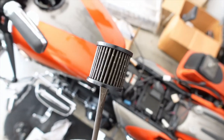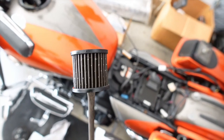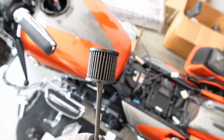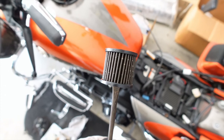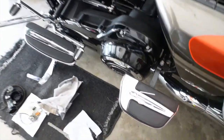Here's how my fuel filter looks. Mind you, I've had this bike since 2015-2016 and I only have about 30,000–33,000 miles on it. Harley recommends you change it at 100,000 miles, but as you can see I need a fuel filter anyway. Every time I tried to start my bike it was acting sluggish, like it didn't want to start, so I figured let me start here and change my fuel filter and see how that goes. Now I'm about ready to put everything back together.